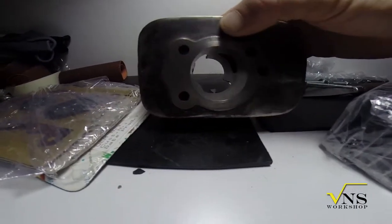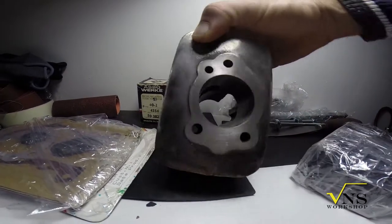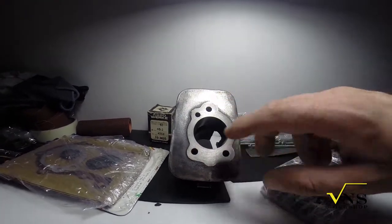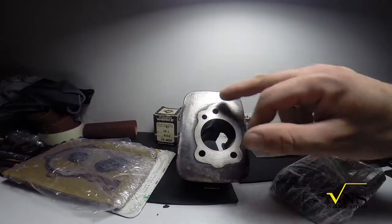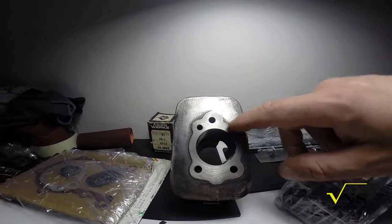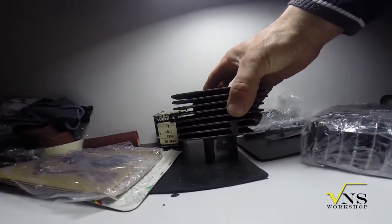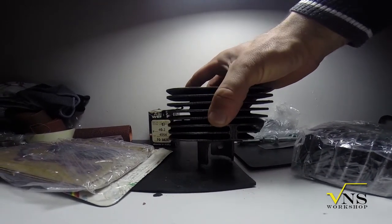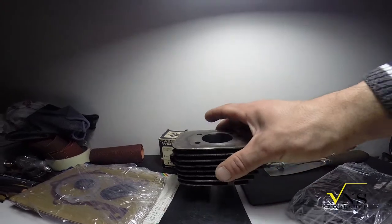You can also see the surface of the cylinder — quite good machining. And here, like I said in the previous episode about the spacer, I removed three millimeters from the top of the cylinder on the lathe, because of the amount that the spacer will raise the cylinder — the cylinder will be raised by the spacer by three millimeters. So that's all for the cylinder. From now we are ready.